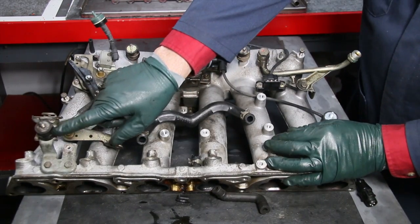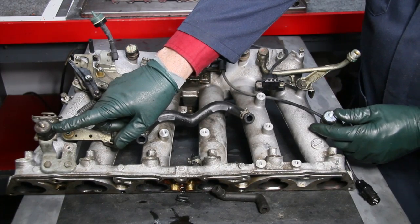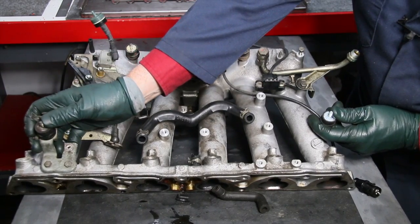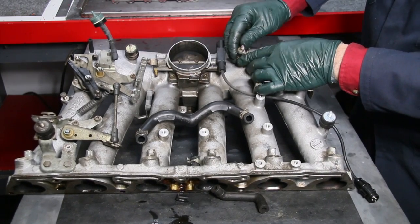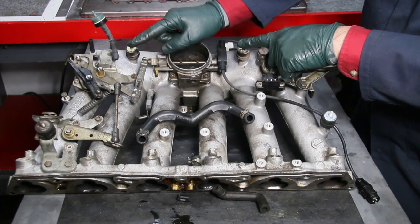It's not just hoses. Look at these rubber mounts — these are the rubber mounts for the air filter housing. See how much this new one flexes? Now look at the old one — it won't even move. Even the ones further from the engine in the back are also very hardened, not much softer. These parts are going to have to be replaced too.